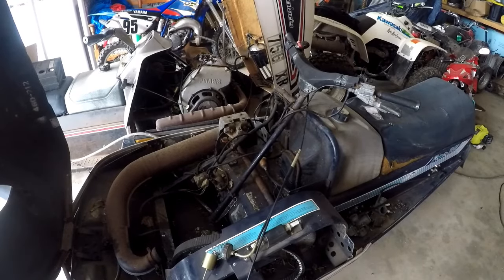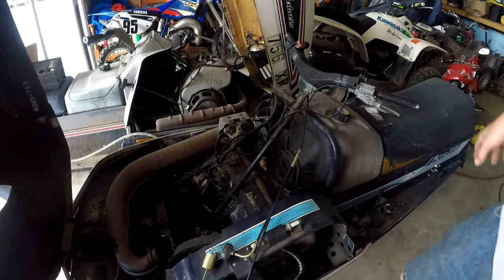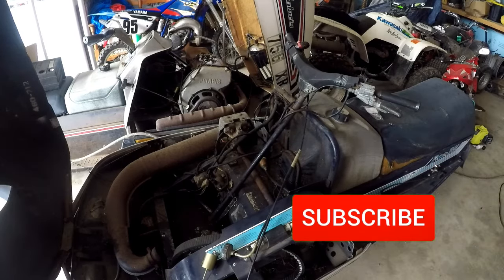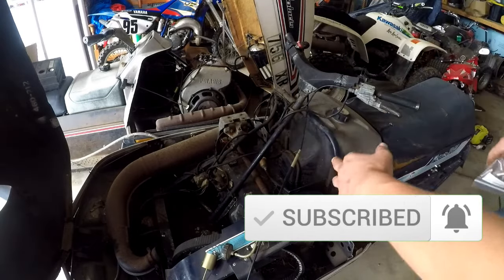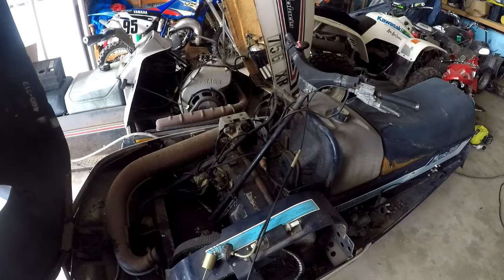In this video I'm going to be showing you how to replace your pickup tube inside your fuel tank on your snowmobile. This happens to be a 1980 TX Polaris 340. I'm going to be showing you how to install — I actually have to put a whole new barbed fitting in my fuel tank. Most of you will not have to do that because you will already have one, but you will have to unscrew it to access the other side of the barb to put your new fuel line on.